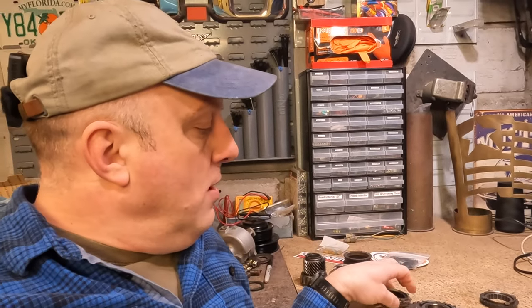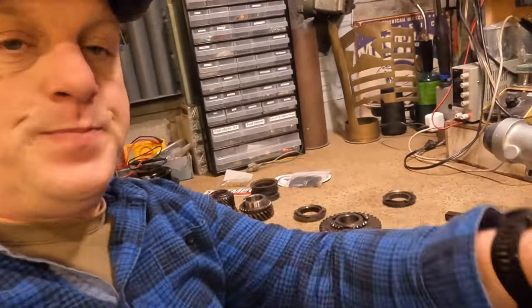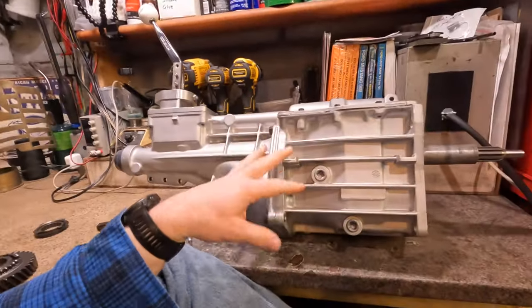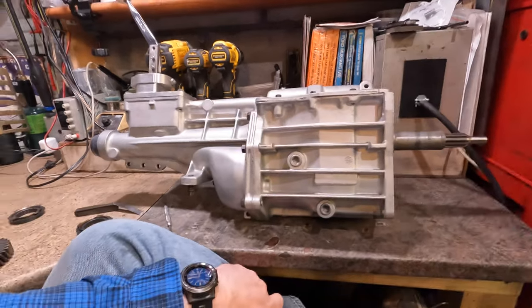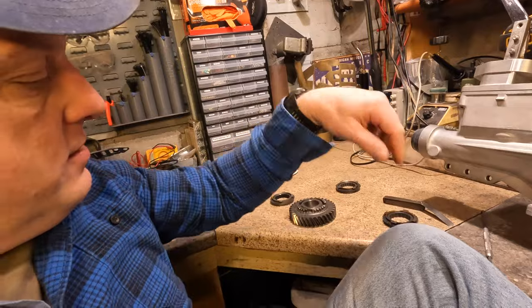About a year ago, somebody came out with some replacements, but there was a problem with them. They didn't elaborate what it was, but they were not able to be used, and I don't know if they all got scrapped or if these are what those were. For 2 years, Tremec has stopped producing them because they're going full boogie on whatever else they're doing for OEMs or the TKX aftermarket stuff. T5s are kind of going to the wayside as far as spare parts and replacements. And so the supply, as far as I know, has been exhausted for the first gear and second gear synchros.